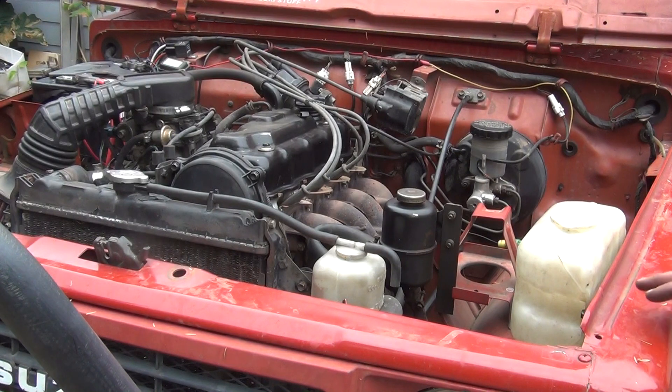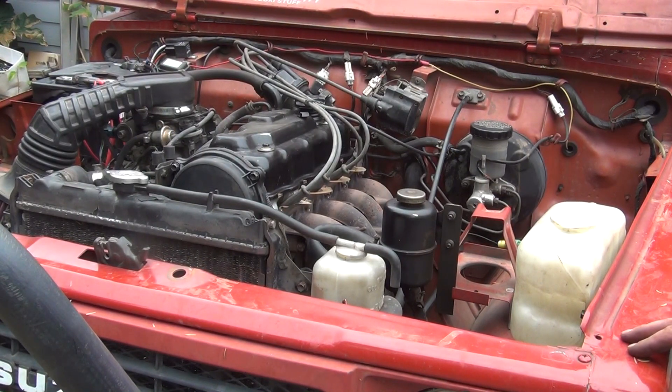Another method I like to use is to spray some kind of burnable liquid in and around the vacuum lines. When you spray the area where the vacuum leak is, the engine will generally rev up — or sometimes rev down — depending on where the vacuum leak actually is. Use caution with this though. You're spraying flammable fluid under the hood, so you want to do it in short bursts and allow the vapors to dissipate. Don't run a constant jet under the hood or you risk setting your vehicle or yourself on fire. I'll be using starting fluid here in little quick short bursts, and you'll hear the change in engine RPM as I squirt near the vacuum leak.